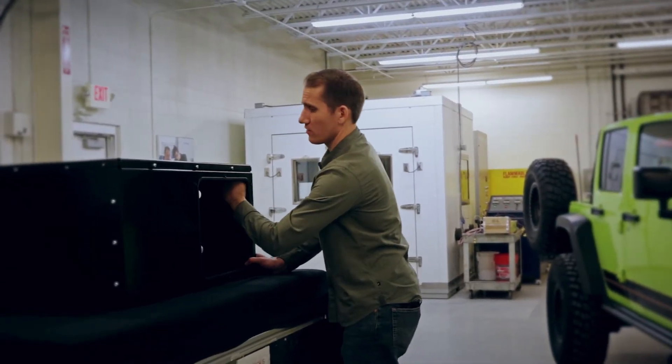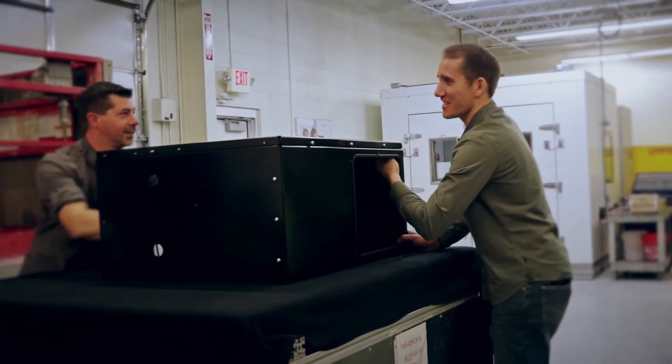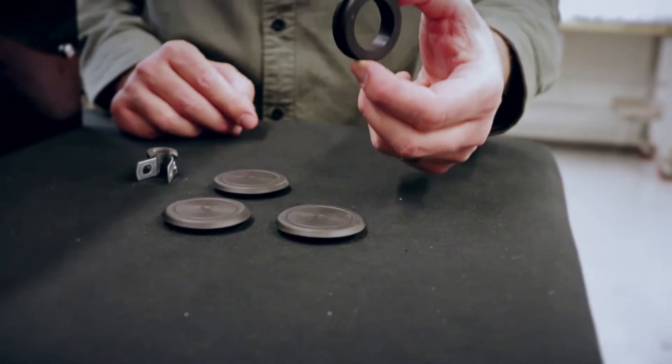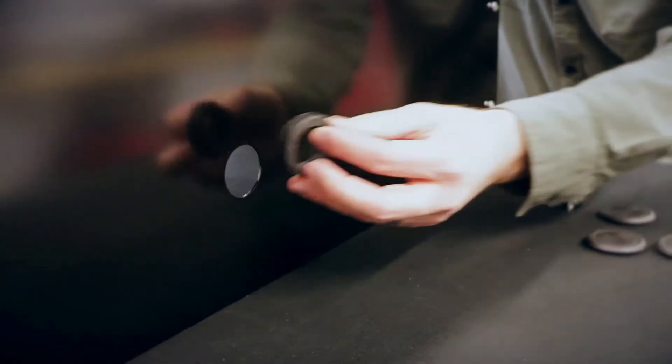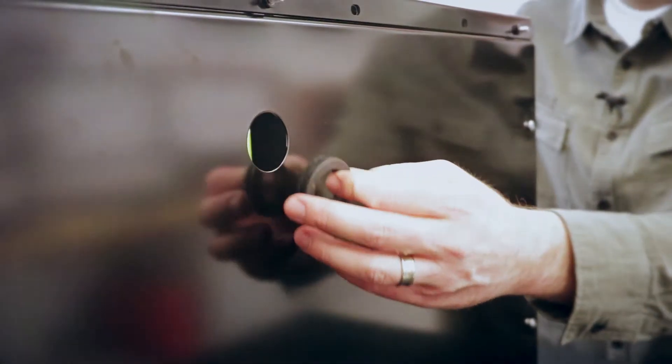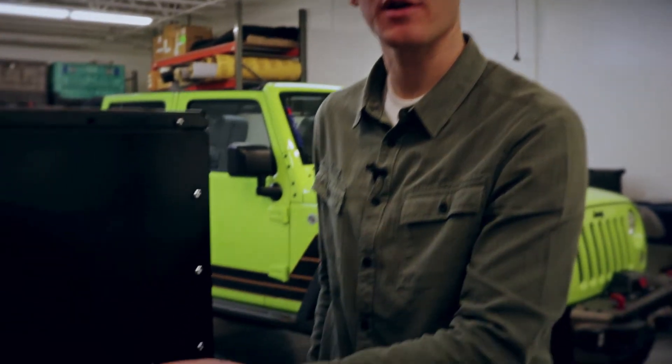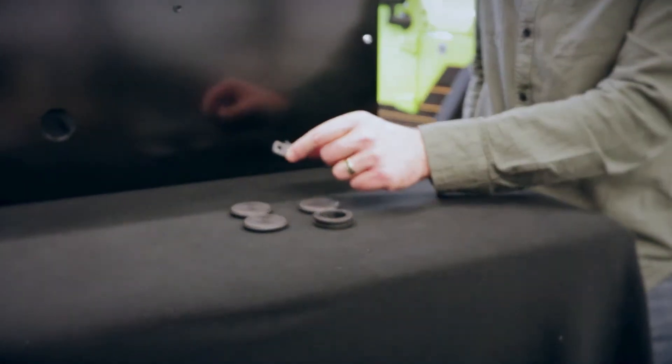Brian's tightening one side, I'm tightening the other. Also included in your kit are two types of grommets: a close-out grommet and a pass-through grommet. The close-out grommet is to close out whatever holes are not being used, and the pass-through grommet is to pass through a power cord for the fridge or whatever else you need. Depending on your vehicle, you'll use either the lower or upper pass-through hole depending on where your outlet is located. Also included is a P-clip, which you'll want to install if you're running a fridge freezer — otherwise it's optional. The mounting location is on the outside but you'll need to install it from the inside.